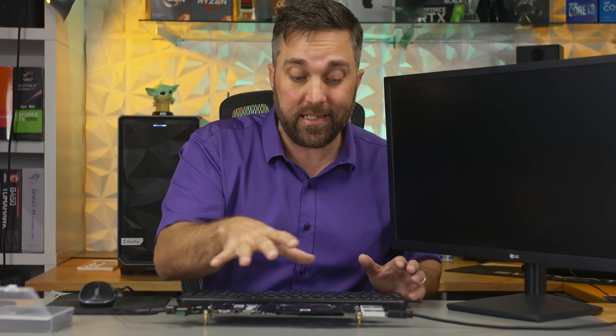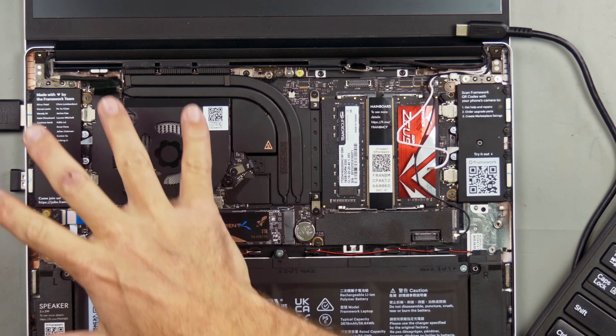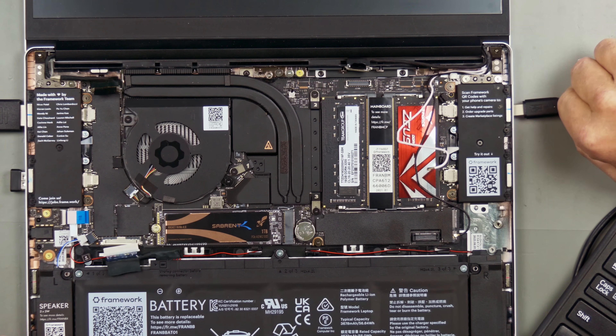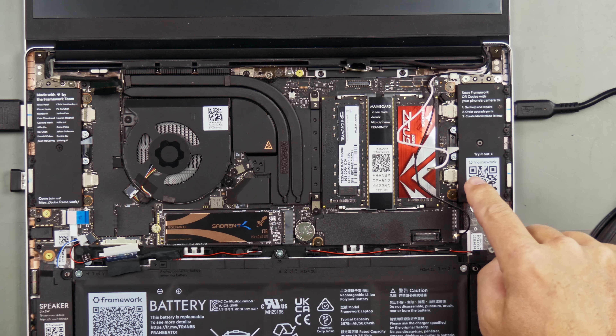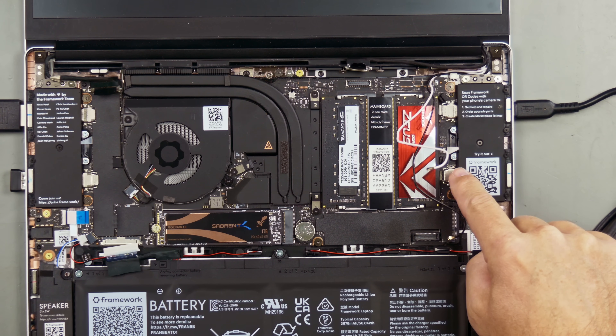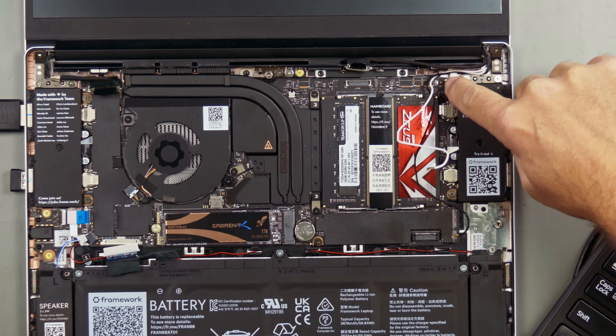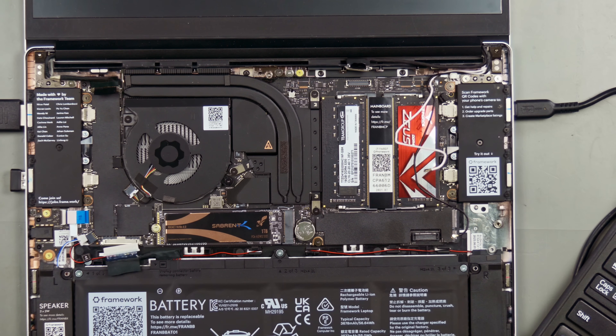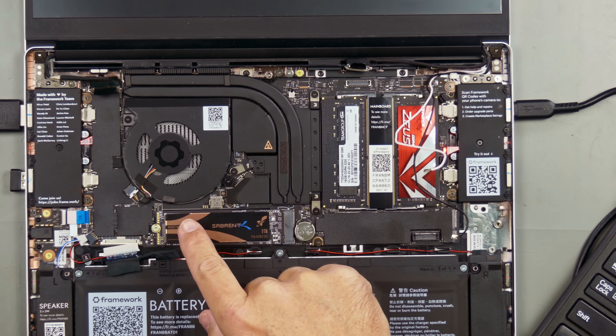Let me put it back in the chassis and see how much can be disconnected with it still functioning. I've just screwed it back into the case with nothing connected — I want to make sure it wasn't a ground fault error. Let's plug it in again. Still seeing the same red flashing light, starts and stops. I tried to boot it while the light was flashing and I saw the fan try to spin up real quick — that's something.